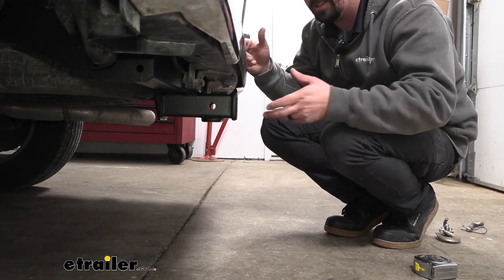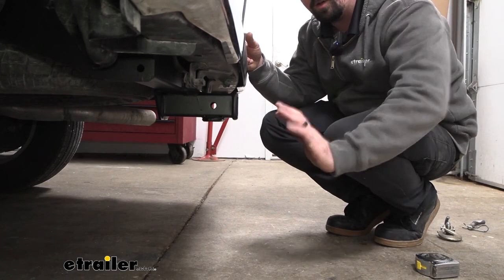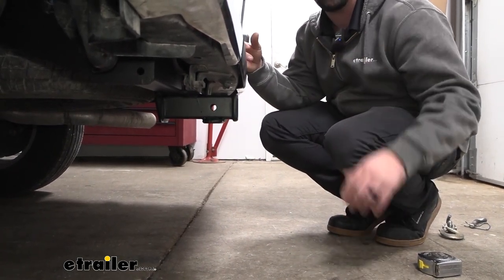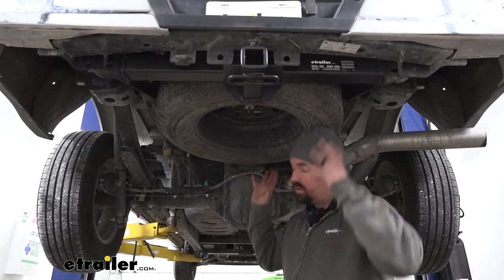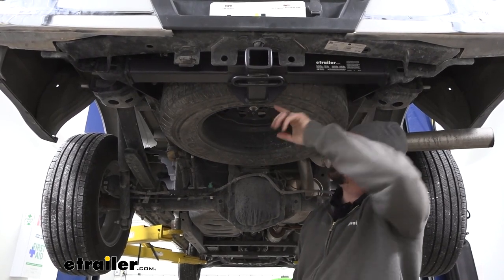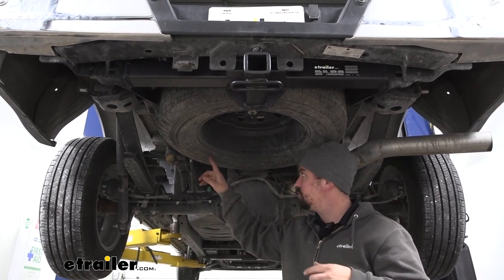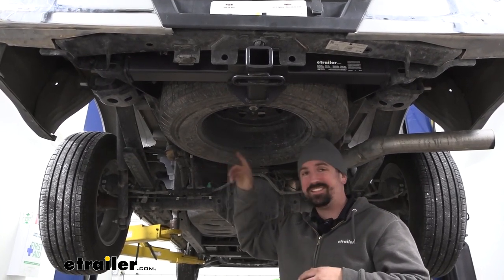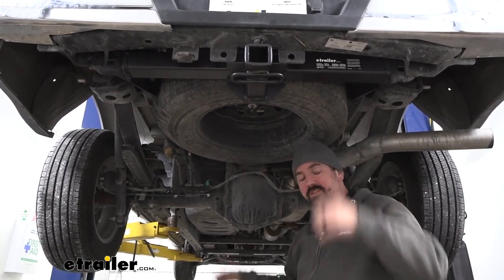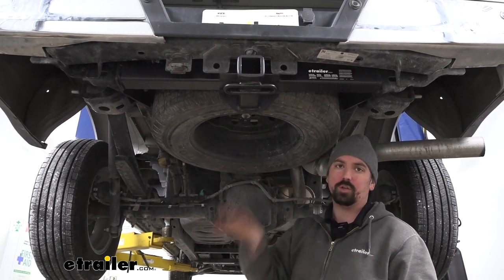Keep in mind if you have suspended accessories like your cargo carriers or bike racks, you're going to have ground clearance, but as you go up an incline, sometimes they can tilt towards the ground and make contact, so just keep that in mind in some severe cases. Depending on what size spare you have under your truck, it can get a little bit tight underneath here. Ours is making contact with our hitch, but I was able to get this back up in place. The tires we have on this one are a 245/70/17, so if you have larger tires, that might be something where you may not be able to get your full size spare back up, but if you have this tire size or anything smaller, it should work just fine.